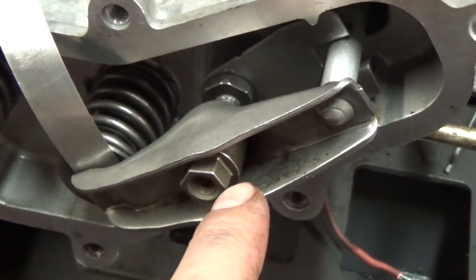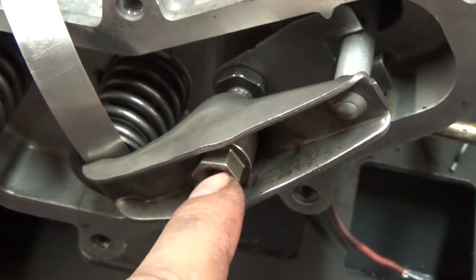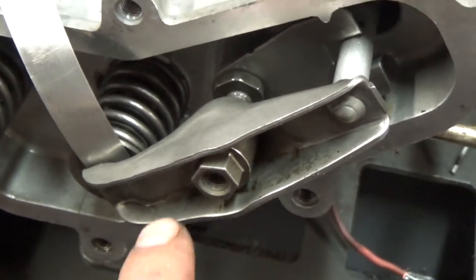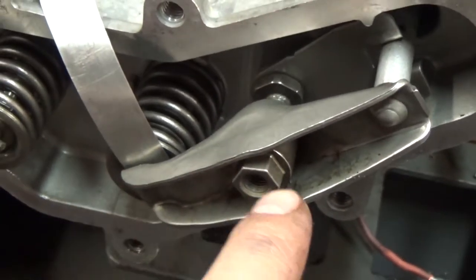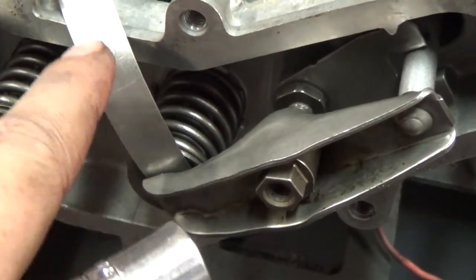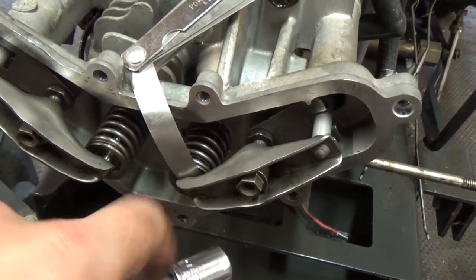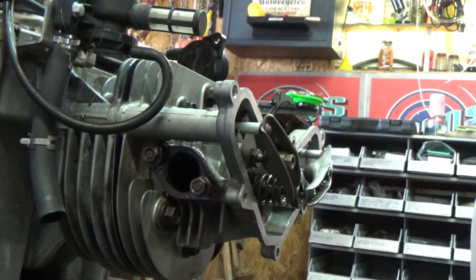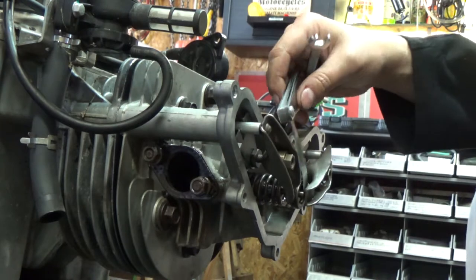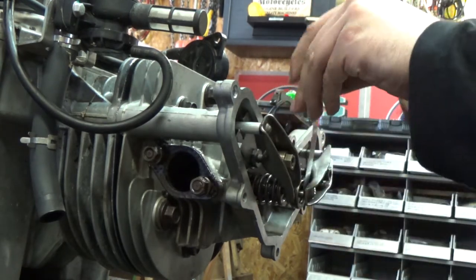However, you're gonna have to hold this nut in place when you tighten up that set screw. Because if you go to tighten up that set screw, you're actually gonna rotate this nut, which is gonna tighten this further. And then once that's all tightened up, you won't be able to pull that out and it'll be over tightened. So you'll actually be less than 5 thou, because when you pull that out, you won't be able to get it back in. Now again, guys, this is super finicky, right? So like right here, you guys can see that's way too tight and I can't get it back in.